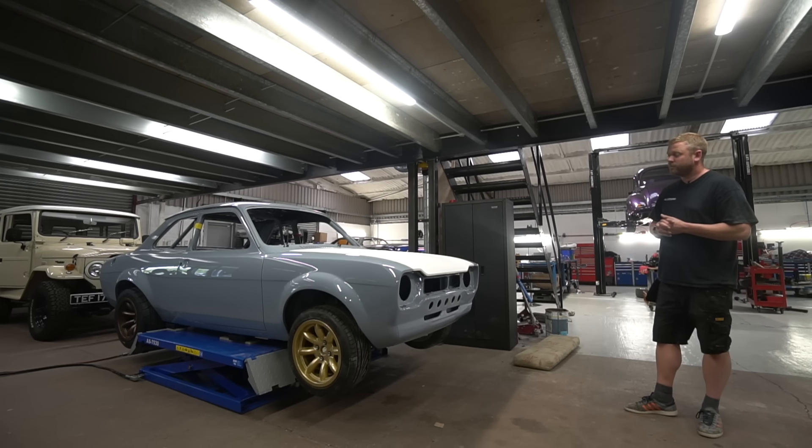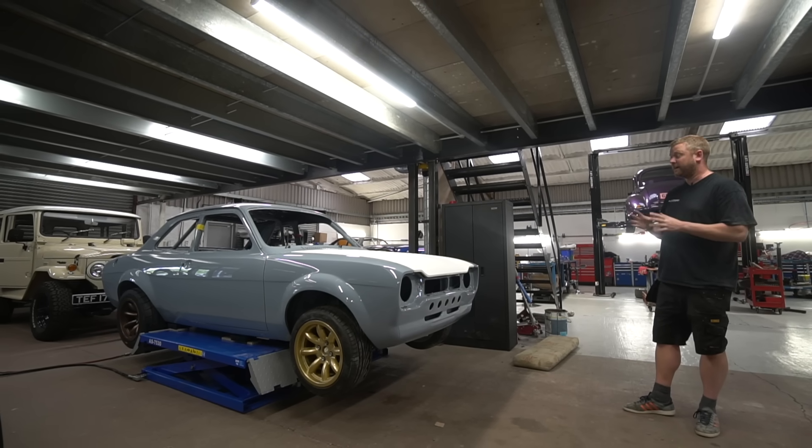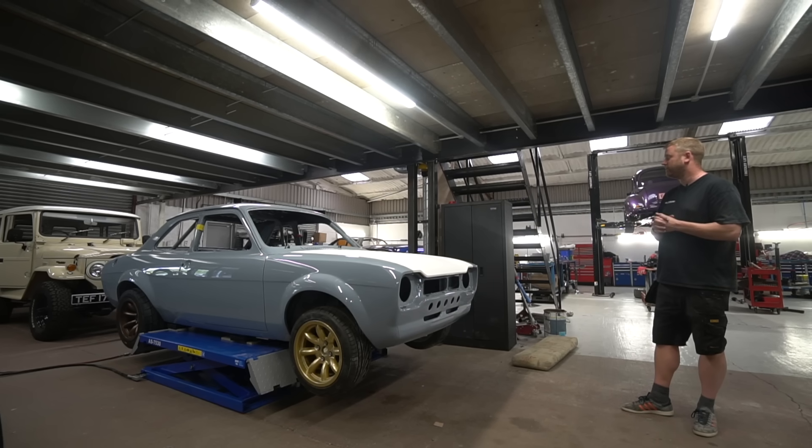The centre console design is being finished — it'll have a recess for your phone, USB socket, gear stick surrounded by three buttons for headlights and front/rear heated screens, and a little rotary controller at the very back for audio volume. With the 3D scanning facility we can scan for things like door panels — the plan at the minute is to water-jet the door cards out of ABS plastic with all the detail already in them.